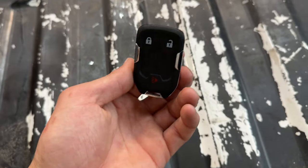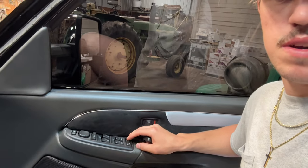Boost Auto Parts sent me this 2020 Plus key fob. The process of programming it is actually really easy — takes about three minutes or less. Boost Auto Parts has an installation video and written instructions, but essentially you hold down the unlock button, cycle your key twice to enter programming mode, then hold down the lock and unlock buttons for about 30 seconds until you hear your horn beep. Then to exit programming mode, just turn the key to accessory mode.